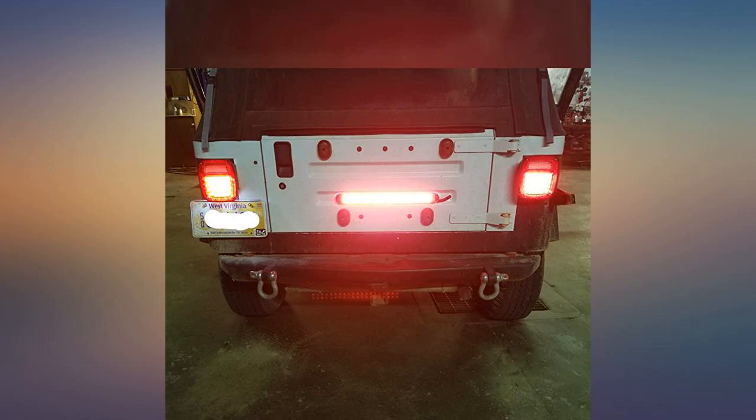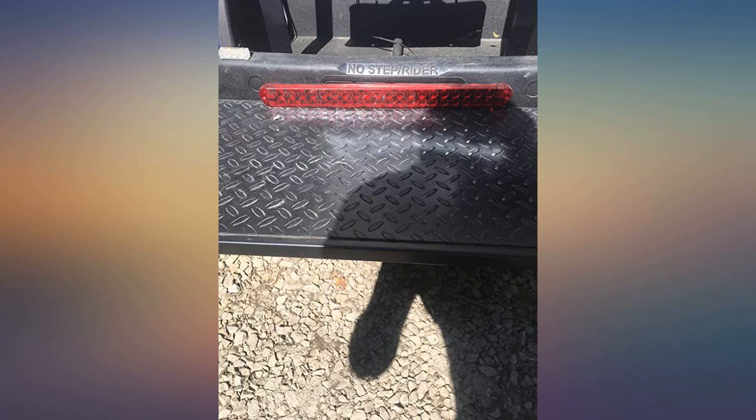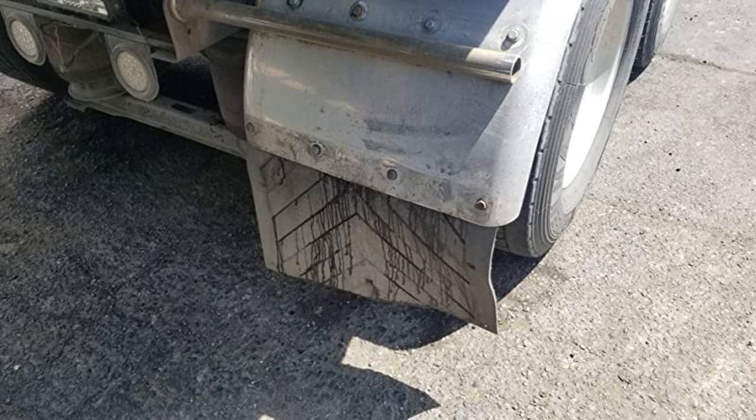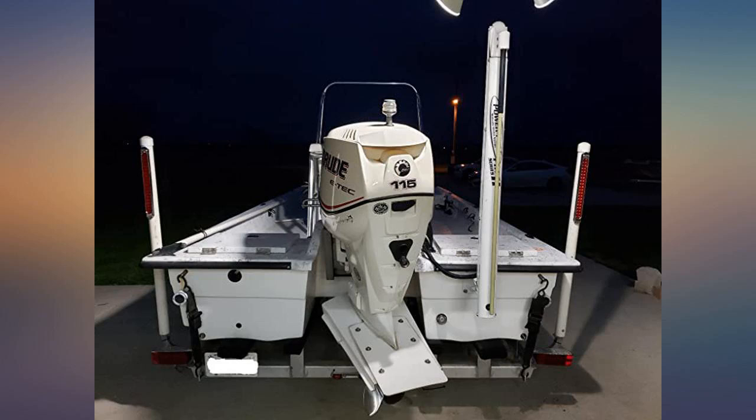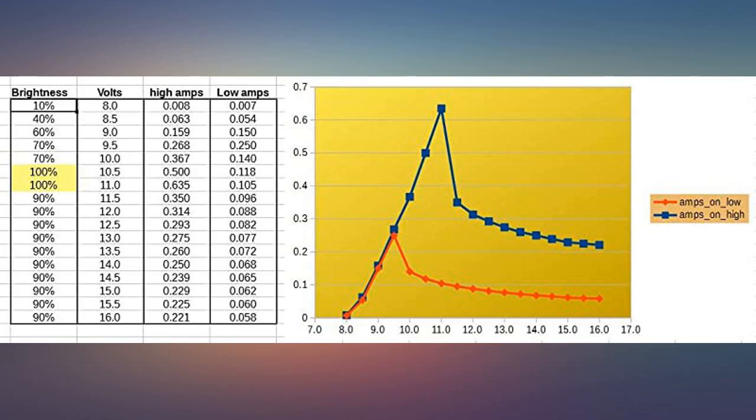Put them on my boat trailer and they work awesome. Perfect brightness on running lights and brake lights. Had some signaling issues initially, but was resolved after doing main trailer ground. Make sure both lights are grounded well and preferably short ground wires. My ground leads are 4 inches.